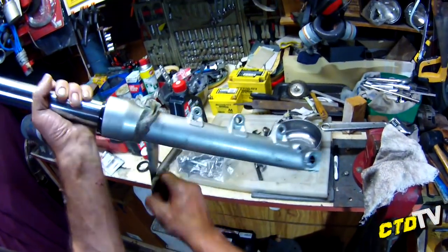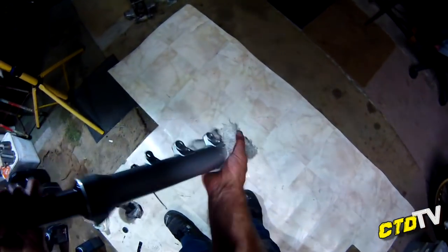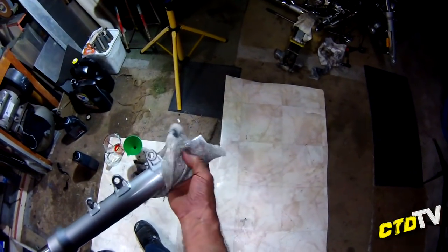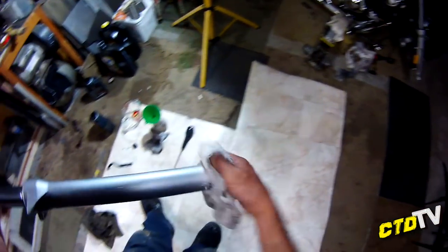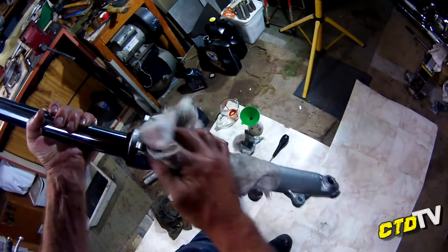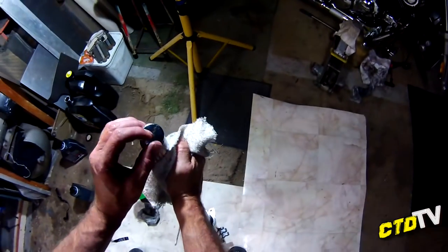God, these are soaking in oil. Look. Now don't just go and compress these because they have balancing pipes. As I did before, it'll come spewing out the top at that hole. So don't just go pushing them up and down, and certainly watch it when they're upside down. You don't want to put them upside down. Cool. And that's the job done.